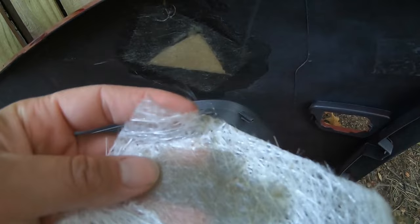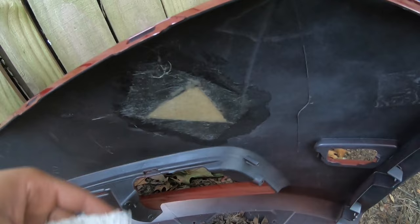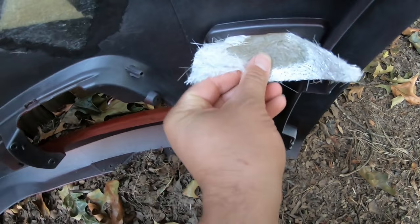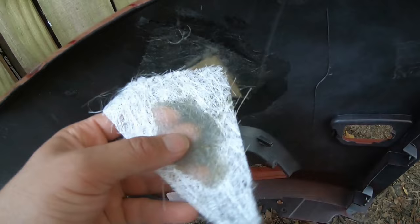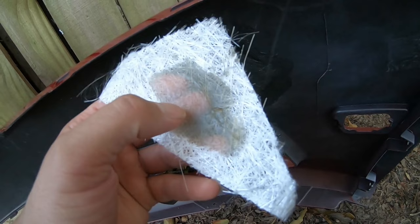This is a piece of fiberglass I just put on the side to show you — it is solid in the center but soft on the sides. If you don't have access from the back, you can coat the sides through the front with just a brush and resin, then fold it and insert it into the hole. If you're worried about it falling, put a nail or a U-shaped piece of wire through it — once you're done, just push it back or cut it away since it'll be covered anyway.